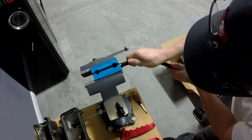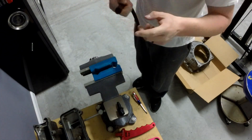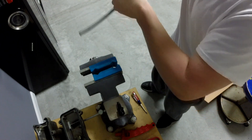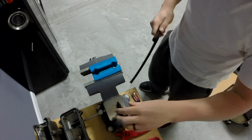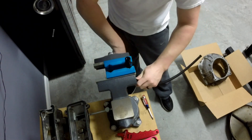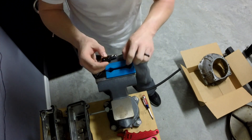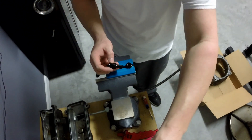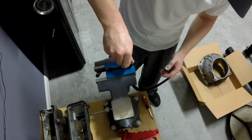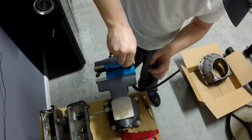After that you just start spinning — hope to god it goes in. Now that I'm done, it has bottomed out inside. There are still threads in there, but it bottoms out itself. Give it a quick another spin. Looks good. Now the next part is putting in the metal adapter. Put it in the jaws. Some people grease up this part because you're going into rubber so it does want to tighten up on you. But for me with these little Dash 6 fittings, they're so small I don't see the necessity in it — that's just my way of doing it. You don't have to follow the way I do it.